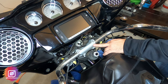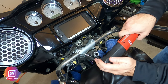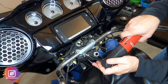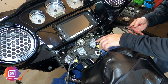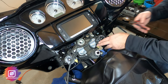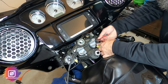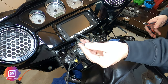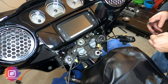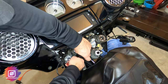It would probably be a lot better if you had somebody to hold the bars — I do not. After you've moved the riser plate, you're going to find additional zip ties tying up the brake and clutch cables, so just be careful not to snip anything. There should be another one over by the riser. You just want to get as much slack as you can so you don't have to replace these lines. At 10 inches you shouldn't have to replace them with 12s either.